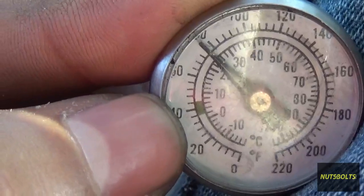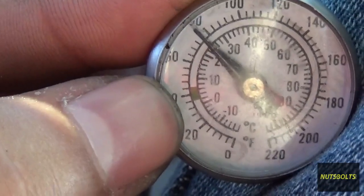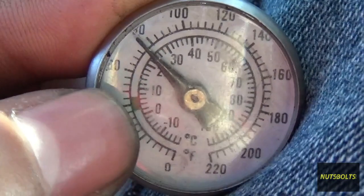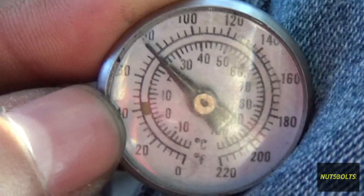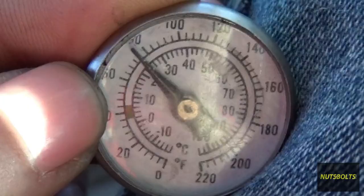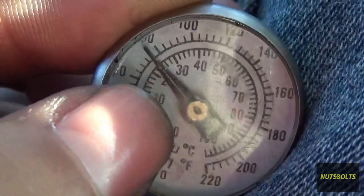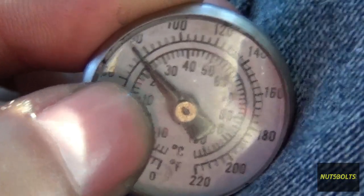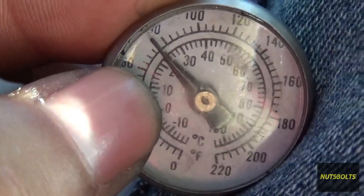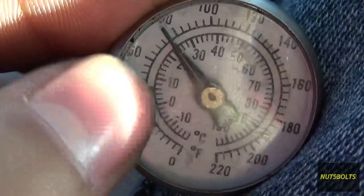At 32 degrees that's already freezing, so it usually keeps around 33 or 34 — you'd probably see around 43 to 45 degrees at the vents on a perfect system. With this retrofit, having it absolutely perfect is not going to happen since the system was not designed for R134a. You'd probably see around 50 to 55 degrees. In our case right now we're seeing 60, which is a little too high. We do have a proper charge, but cleaning the condenser would probably help drop those extra five degrees down to around 55.